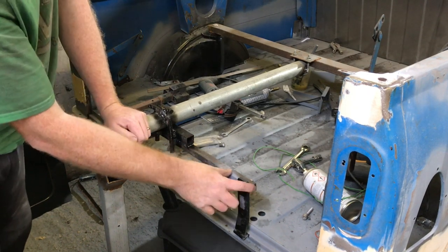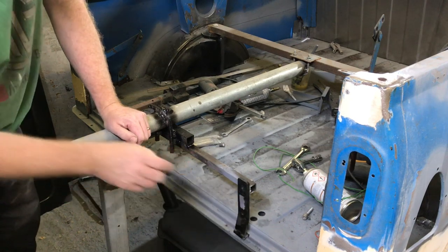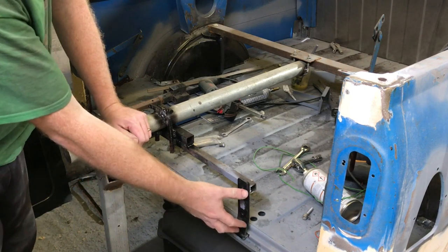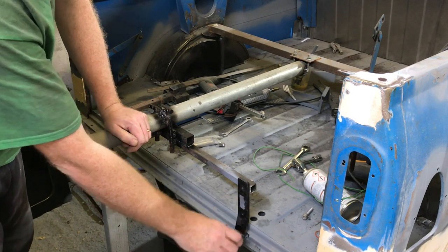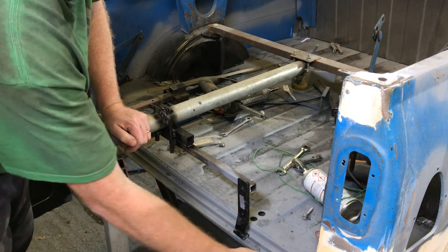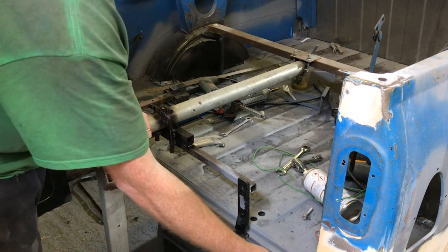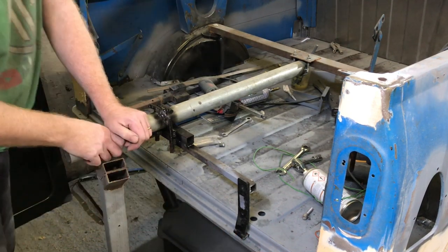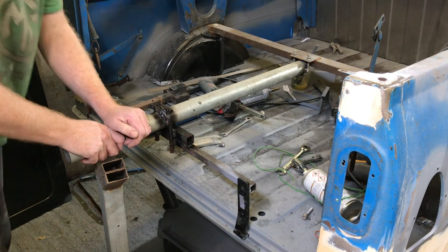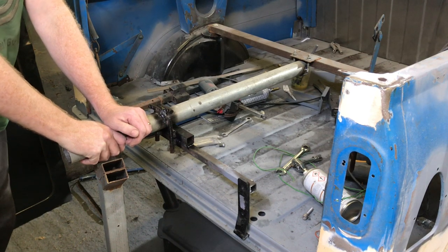We need to spread this load into something else — not pulling it that way. What we could do is get rid of these hinges and actually just make something much stronger, tougher — welding plate in there rather than wiring on the hinge. We could also spread the load up the seam, and fix onto the bumper holes as well. Well, it's good to think these things through. Obviously, if anyone's copying me: don't — wait till it's finished. Oh well, that's wasted an hour, hasn't it.